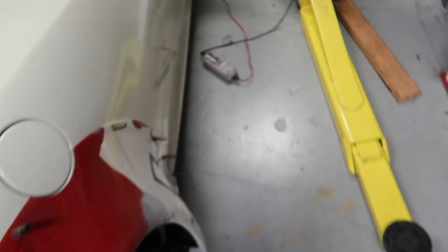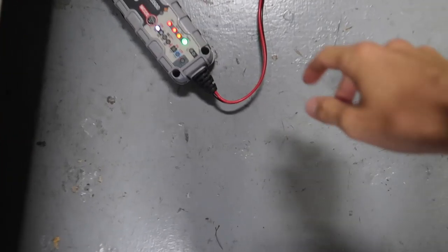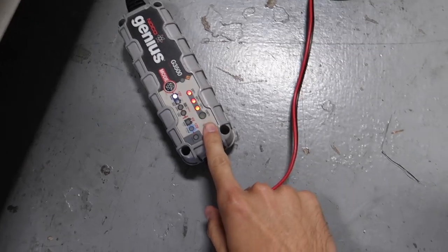It's now 24 hours later. The car would not start yesterday, even with all of our jump boxes. With some research online, sometimes people say these cars need 100% of their battery to turn the motor over. So long story short, before we have to troubleshoot how to start this car, get a new battery, and go through all that, I ended up putting my battery tender on this car overnight. After about 24 hours, we're finally at 100%.